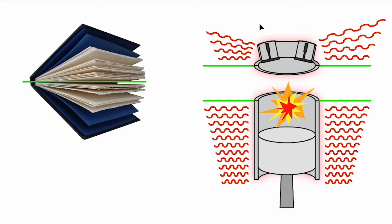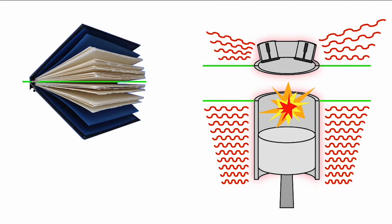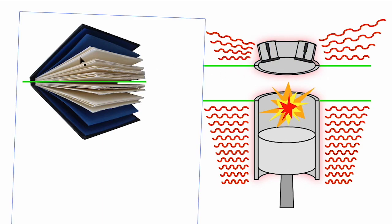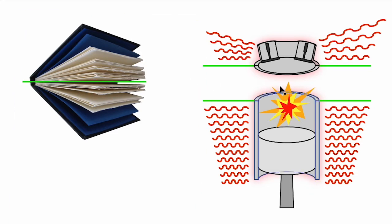These are two parts that are bolted together — the cylinder head bolted to the block. What I'm representing with these green lines is like a book coming together, where the spine is where they meet. Imagine peeling those two parts away, so we're looking at the cylinder head up here and the block down here, but they would really be mated together at that green line. As these combustion events occur, they give out tons of heat radiating through the walls. I'm making the squiggles bigger near the top on purpose, because heat rises and collects at the top. Up at the cylinder head there's a lot more heat, and especially on the right side as hot exhaust gases are being routed out of the head — heat is really going to want to congregate around there.